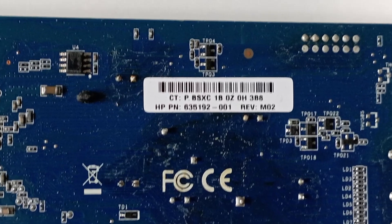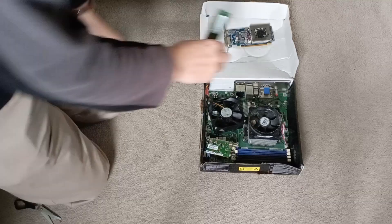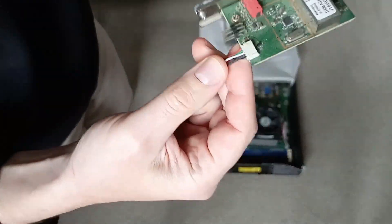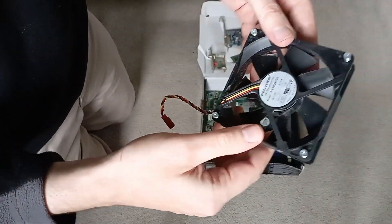Looking at the codes, it is the fairly uncommon GeForce 405 1GB, which is basically a faster clocked GeForce 210, so stuck on DX10. There's 4GB of DDR3 memory. We also get what looks to be a TV tuner card, which I guess may have been powered by an internal USB port that has now been cut off, so this is probably junk.